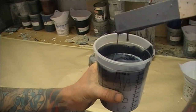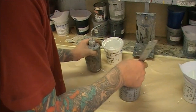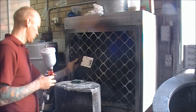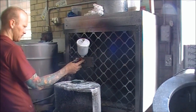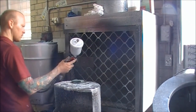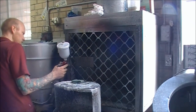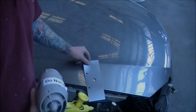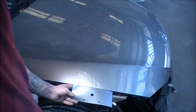You lift it out and say, oh yeah, that might still be a little bit thick, so I'll add a touch more reducer. Once we're happy and got it stirred up, we'll grab the spray gun, put it in the gun, and do a test card. Try to replicate the same spray fan and spray pattern you're going to use when painting the car, because if you spray it a little bit differently it will change the color. Air pressures and distances from the panel can all adjust the way the color comes out. You can blow air onto it between coats to help dry it, and instead of putting clear coat over I'm just spraying it with wax and grease remover — I've found it's a good way of giving it a bit of gloss without having to clear all your test cards.